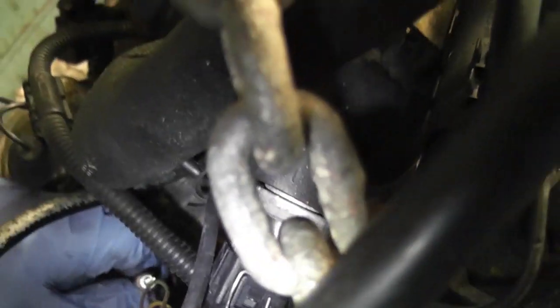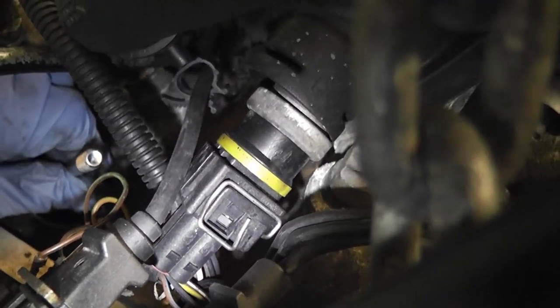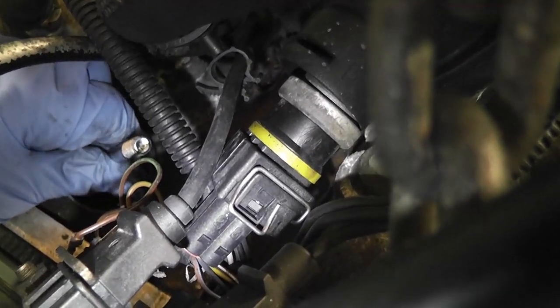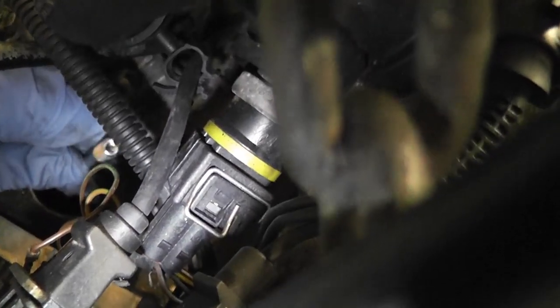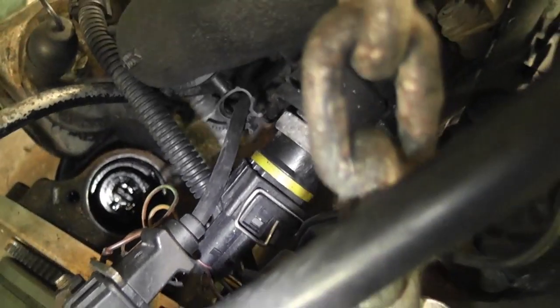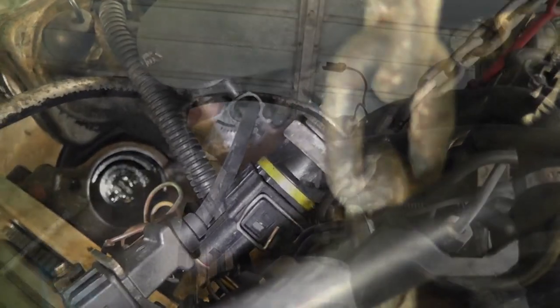You can see I'm now turning the oil pump with the bolt. So what I will need is an extension, but by way of an extension, I can put a couple of nuts on the bolt and use the drill with the socket adapter on it. And that should do us. So we need to spin that quickly in a clockwise direction. So let's try doing that.